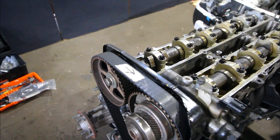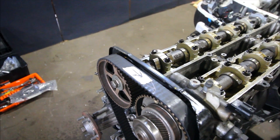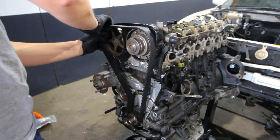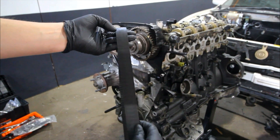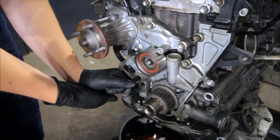If you're planning to reuse your timing belt, make sure you draw an arrow in the clockwise direction so you put it on in the same direction as you took it off. Inspect your belt for any cracks or frays and replace it if it has them, and store it in a dry place without oil or dust.